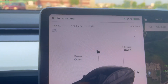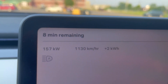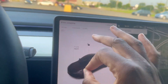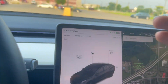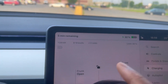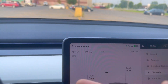It's good to see that in the summer you don't really need a car that preconditions — you'll still get fast charging. Obviously you'd get faster charging with preconditioning, but you still get a good amount. The peak is already going down though — we're at 156, 154, and we're only one minute in. Teslas don't hold their peak for very long. At the five-minute mark we're at 128 kilowatts. So if you do precondition, you will have a faster charge, and it will last longer.